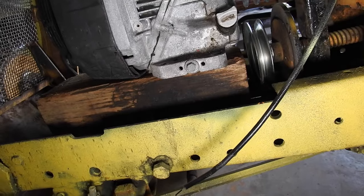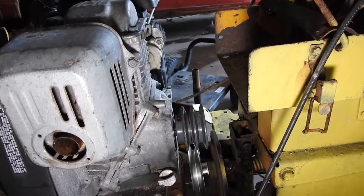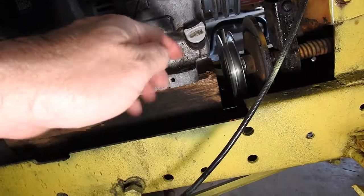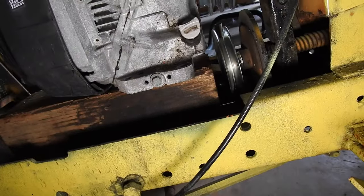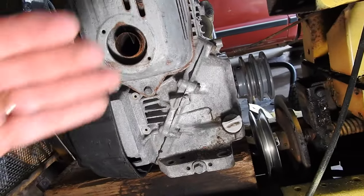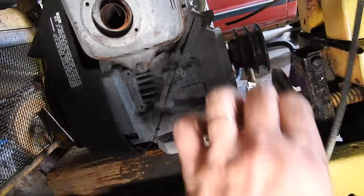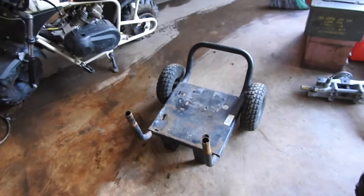We'll see. Anyway, I was thinking I'm going to cut up that pressure washer cart for a motor mount. If I could somehow make that pivot, that could be your clutch. It would be this pulley, and a belt. And when it pivots up, that would engage. Something to think about. However, I don't know if there's room under the hood for the engine to go up and down. I may have to have it fixed and just get another pulley out here to act as my clutch. So the next step, I'm going to start cutting up that motor mount plate.